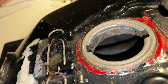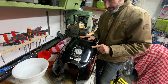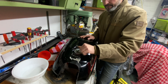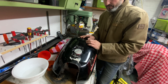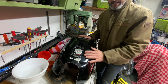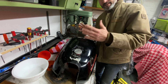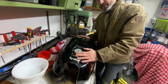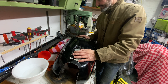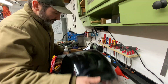The next part is going to be the outside of the tank. There's a little dent here that has to be addressed, and then it can get a paint job, a new o-ring underneath this, and a new fuel cock — and then this tank is ready to go on the bike. That will be the first part of the fuel line and the ignition and running of the engine. After this it's going to be carb work again, but first off get the WD-40 and try to stop rusting.